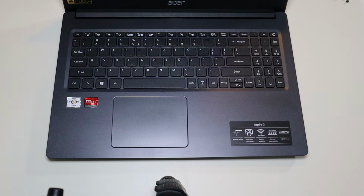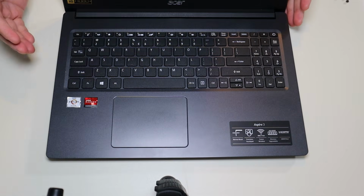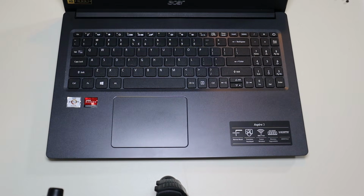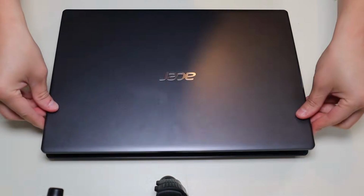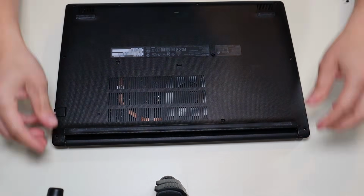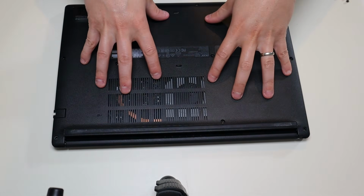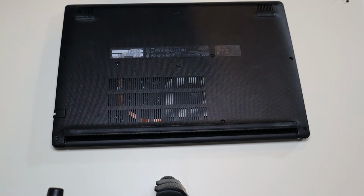We're going to try power draining your computer in a couple different ways. So first thing you want to do, unplug your charger. Make sure your computer is not plugged into the charger, and then we're going to remove or unplug your battery. Some of you will have an easily removable battery on the bottom. It'll just slide out from your computer. Others of you, like this computer, your battery's inside. You'll have to access the inside of your computer.